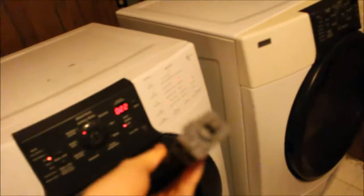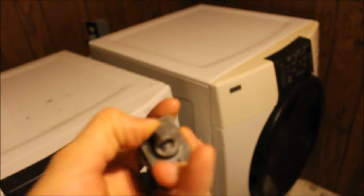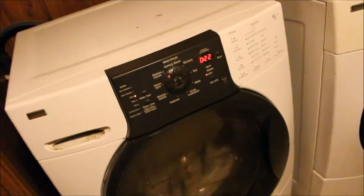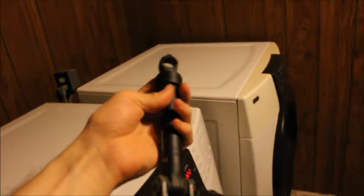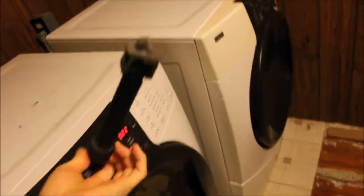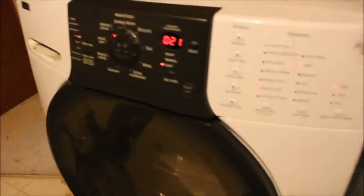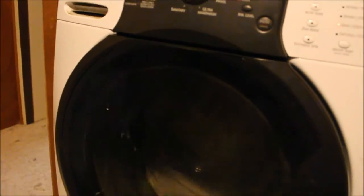The left side was broken, and then I discovered the right side was broken too. You can see it's cracked — one pin there — and just one side was holding. I was like, that's gonna make it a lot worse. Anyway, what this thing does is it's got grease in it, and there's a plastic piece that hooks down at the bottom. This is what keeps the tub from going back and forth. When your tub goes back and forth, this grease prevents it from going out of balance. I also got it leveled down there to help it from going out of balance. I don't think it's going to spin completely yet — it says 'wash.'